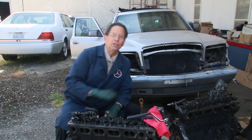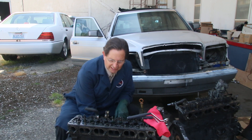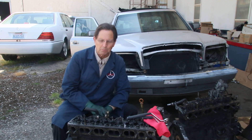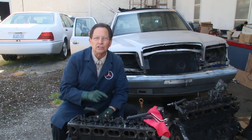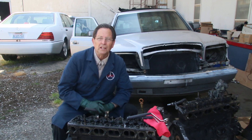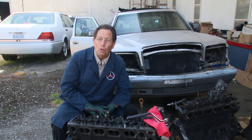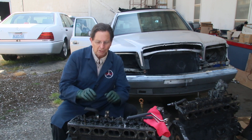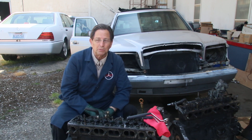What you run into is a problem with one of the adjusting nuts. I'm going to show you here how these nuts work. You'll be able to see them clearly because the valve springs have been removed and the camshaft has been removed. A lot of people are running into this because these valve adjusting nuts are getting old — they've been adjusted maybe a few dozen times and they've been over-torqued, which puts strain on the threads of the lower nut.